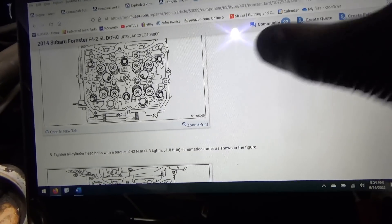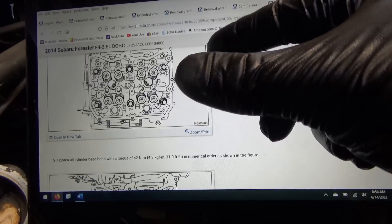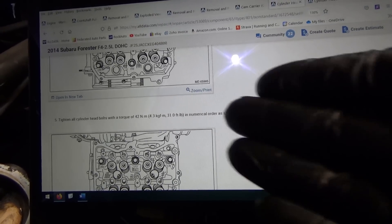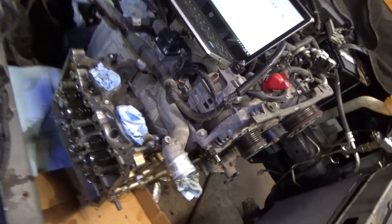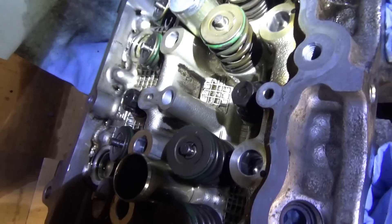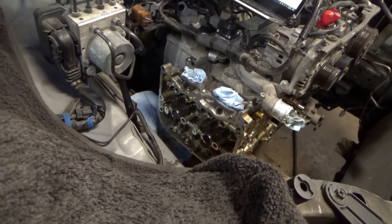This is to pre-stress the bolts, not necessarily to crush the gasket and release it. Let's go evenly - 50, 70, and 90 foot-pounds. I'm at 50 foot-pounds and you can see the marks we made - it's actually a good thing. Less than a quarter turn to go on all the bolts - they're nice and even. Let's go to 70, and then 90.